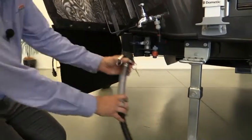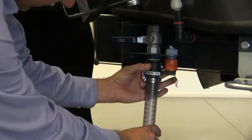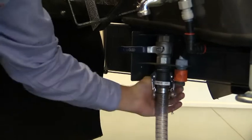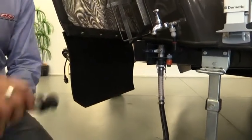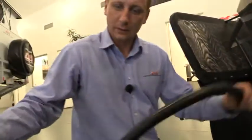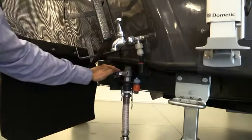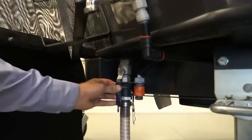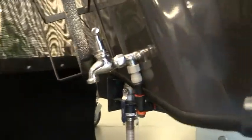We're going to attach our hose to our outlet, which is at the front of the trailer on the passenger side. Safely secure the cam lock, then place the end in the dump point or wherever you're going to dump the toilet. Open up the ball valve to allow anything to come through, then go into our front boot and open up the black locks and open up the handle.